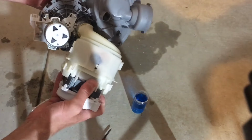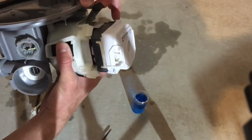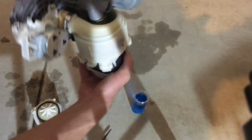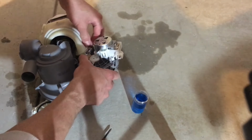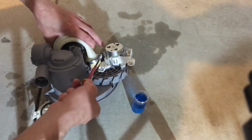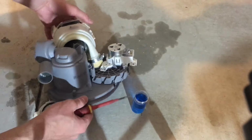Next, put the wash pump in. Put this rubber onto the sump, so this will hold the wash pump in place. Sorry, I've got a broken finger. Can't put this on that easy. So this is pushed nicely and tighten this clamp. Okay, that looks nice and tight.